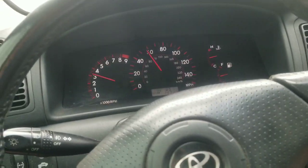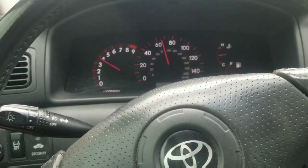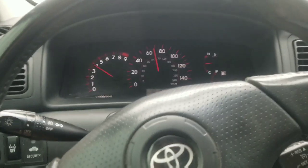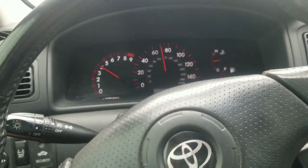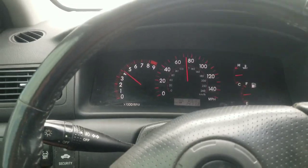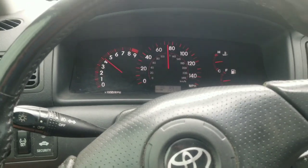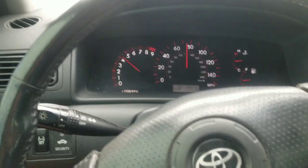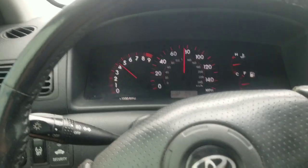He's a little ambitious, but I mean, guys, look, this build seems like it has a lot: cams, pistons. But honestly, those are the only power adders, and the port and polish. So, you know, I didn't go crazy. The car already is 11.5 to 1 bolt stock. This is 12.3 to 1 compression. So I didn't go too crazy of a compression.